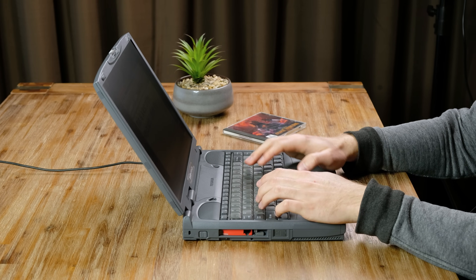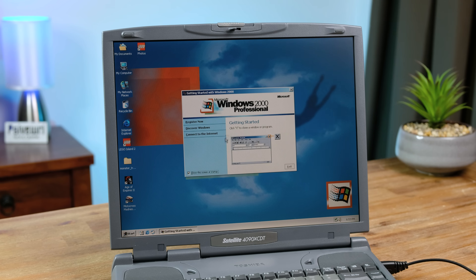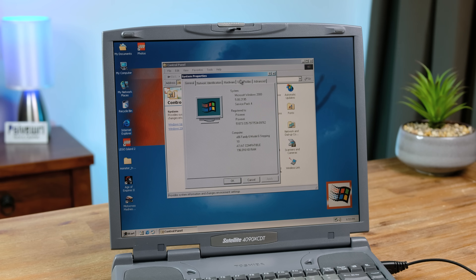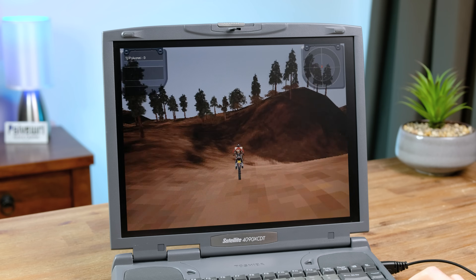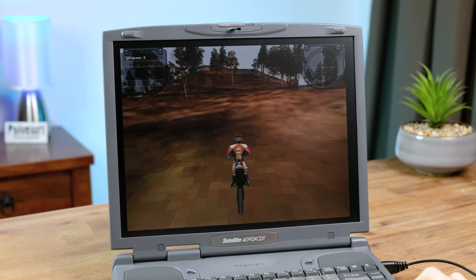Let's try out some games and see just what this laptop is capable of. I'm pretty sure that brought back some memories for people of a certain age. We've got the Toshiba running Service Pack 4 and now with 192 megabytes of RAM — it's a lot more zippy than it was before. I had planned on playing some graphically intensive games to really push it to its limits, but the 2.5 megabyte Trident 9525 DVD integrated graphics card was honestly not up to the task — or I was having some weird driver problems. The integrated graphics seemed to lack a lot of Direct3D support, so seemingly all games ran in software rendering mode or not at all, giving us some less than ideal results. I tried all the possible driver options I could find, none of which made the gaming experience any better.